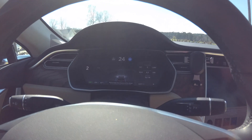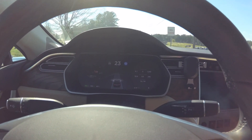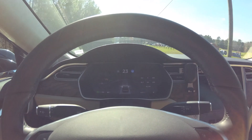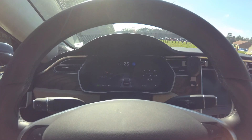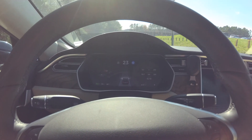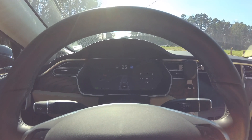Yes, it does! It's actually giving me autopilot with just the fender cameras only. All three cameras up top are covered along with the rain sensor - that's why the wipers are going - but it is just using the fender cameras right now. What I'm gonna do next is take the tape off the door pillars and cover up the fender cameras.